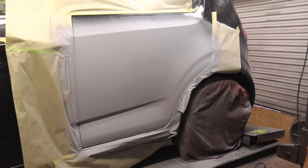If this was a show car, we'd block sand, sand again, prime, finish sand with 400, and paint it. But on this car, we're going to block sand with the DA and 320 and then paint. I hope you enjoyed this video on the purpose of a guide coat — if you did and you'd like to get my latest videos, don't forget to hit the subscribe button.